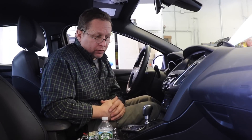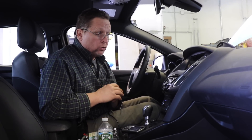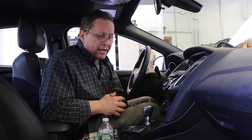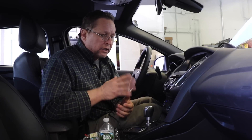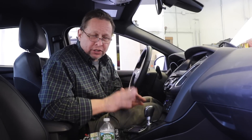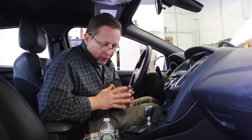It's going to make it more crisp, but my needs are a little different being a rally driver — I'm not after max tune. There are things like when you let off the gas the engine doesn't slow down right away; they call it a shift assist. It helps you shift, and maybe it's a little cleaner on emissions, but when I'm trying to link corners together going from a left to a right, I give it a quick flip of the throttle and it kind of messes me up if the throttle doesn't shut down right away.